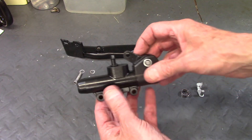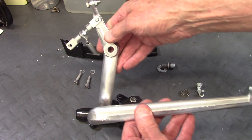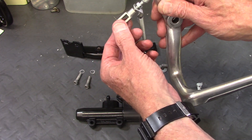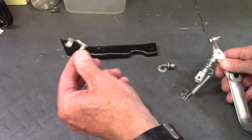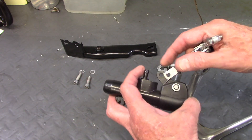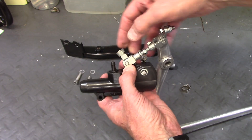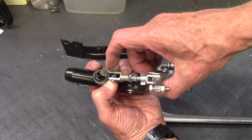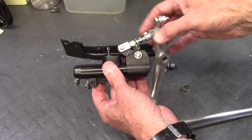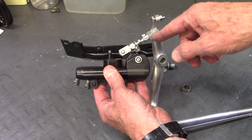To work the master cylinder, this lever arm is moved by the rear brake pedal. It mounts using a linkage which has a clevis on each end and a special pin used to attach the clevis. The clevis slides over the arm, then the pin comes in from the back, and a little clip rotates and snaps over the shoulder of the clevis to secure it. That's how it works on both the brake pedal and the master cylinder.